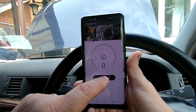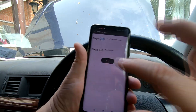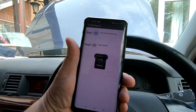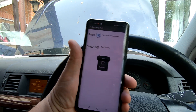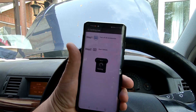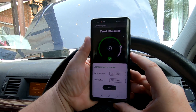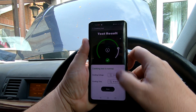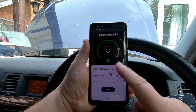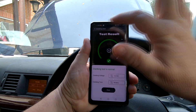So it's telling us there is a problem. Now it will do the cranking test. Turn off all accessories and start the vehicle — the car did start, very very slowly. The test comes back saying the cranking test is normal, which I'm a bit dubious about because it was very very slow starting. In my opinion that's not giving an accurate reading.